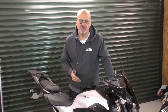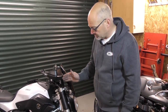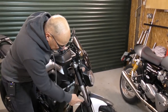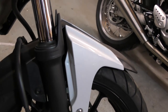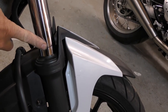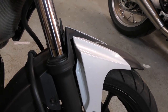It's always a good idea when fitting suspension to get some reference points of where you're working from. What I normally do on a bike is get an idea of what the static ride height is with the original setup. You basically put the weight onto the bike and put a marker — I normally use a marker pen to put a line around the forks — and then when you take the weight off you can see where the bike normally sits. That is your standard ride height setting, and we'll come back to that again later on when we're adjusting the bike so you've got a reference point to start from.